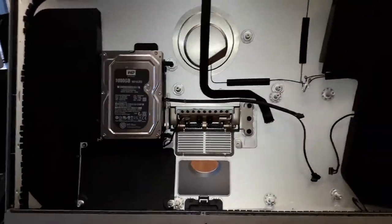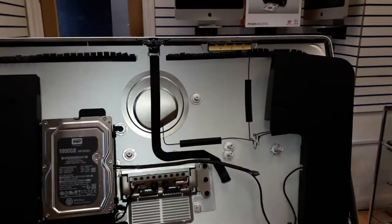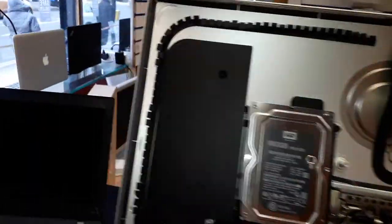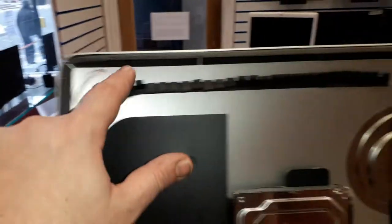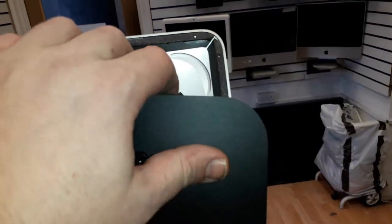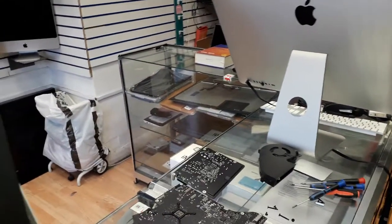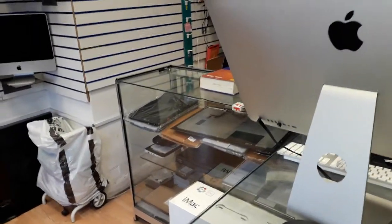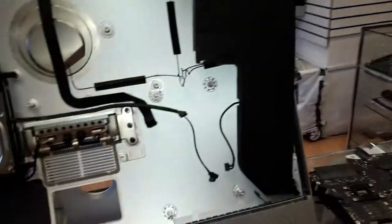If I was the customer, I would exchange the hard drive for the SSD right now, because then they need to glue the screen again. These stickers, as you can see over there, I will have to remove every single one, man. Every single one. And then remove also from the screen every single sticker, and you put a double tape and you put some glue as well, you know, to hold up. That's a really, really hard job. I don't like to do this machine at all. Anyway, let's keep going.